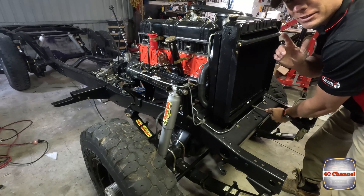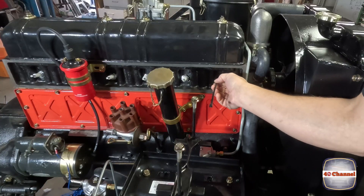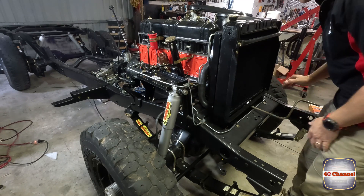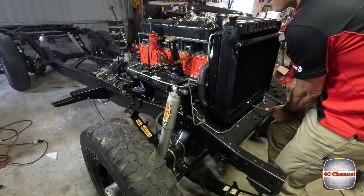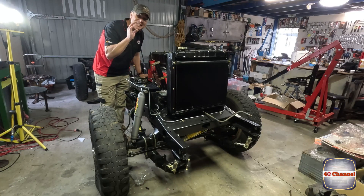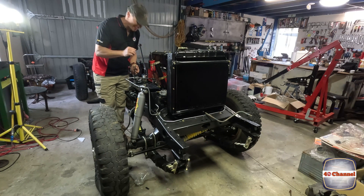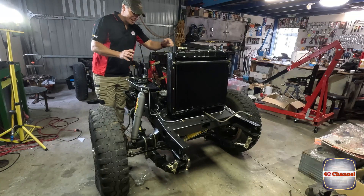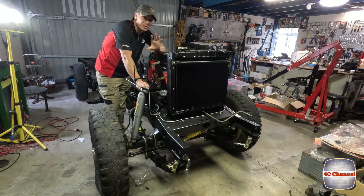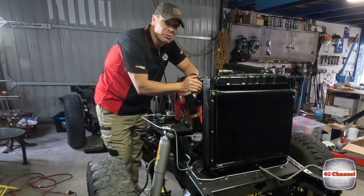This crank handle is actually off an old Mazda - it's perfect for exactly what we need to do. It's not as long as the genuine Toyota one and doesn't quite clear where the bumper would be, but for what we need it's perfect. The tricky part is getting it onto that top dead center mark and not going past it. We'll get our cable tie and slide it in where we removed the spark plug. I can feel that it's at the top stroke. Our needle is smack bang on that mark - we set it exactly on there just so we can settle the distributor up, and then we'll do our timing after.